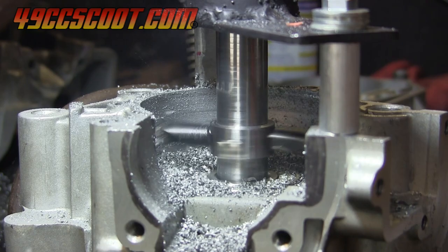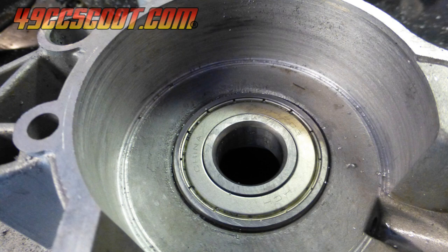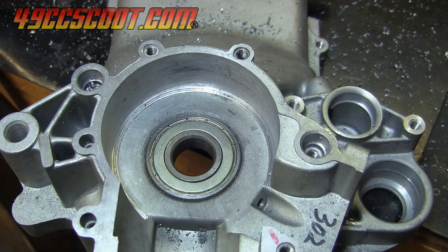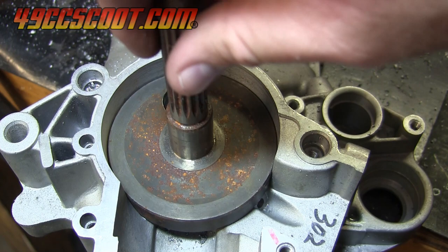I got through another full pass with no real hiccups. I cleaned the case up and took a few pics. Then I grabbed part of an old crank to see how far off it was, and it actually fit after just two passes. It didn't have much clearance around it at that point, so it would need another pass, but I was pleased with how well the tool removed large amounts of aluminum.